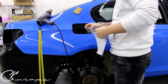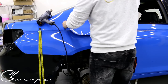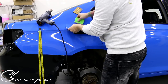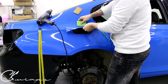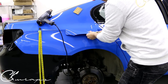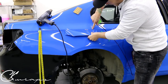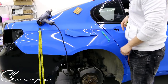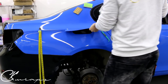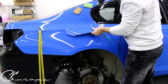What I'm going to do is start by laying the top. Once I get just to this corner right here, what I want to do is pull it over. What that does is create less bunching up of film right here, so I have a lot less slack. If I want that a little bit more exaggerated I can add a touch of heat and just stretch it out.